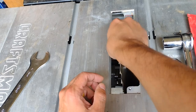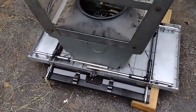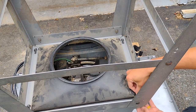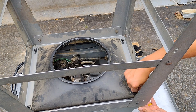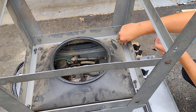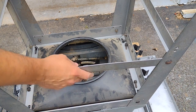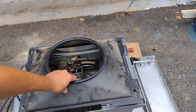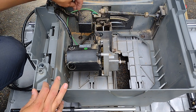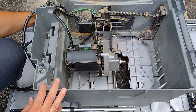Now I take the blade out. So this machine is upside down - this is the bottom of it. You can tell it's on top of wood because I don't want to damage or scratch the surface. Now just remove everything else - all these bolts. That's one out, that's a second - all the bolts are off. So now the plate should come out. There's a wire that goes into this box, so we got to remove this box so we can disconnect the wires that go with the motor. There are two screws holding that box from the other side of the machine.